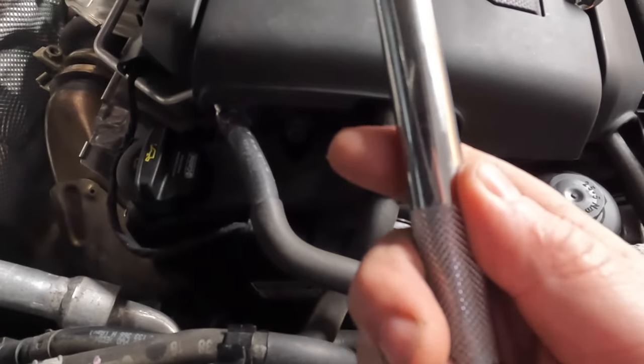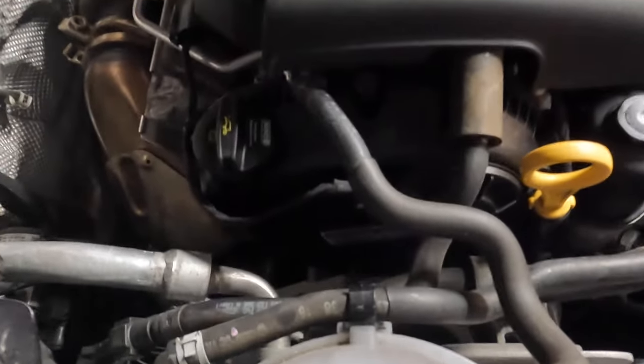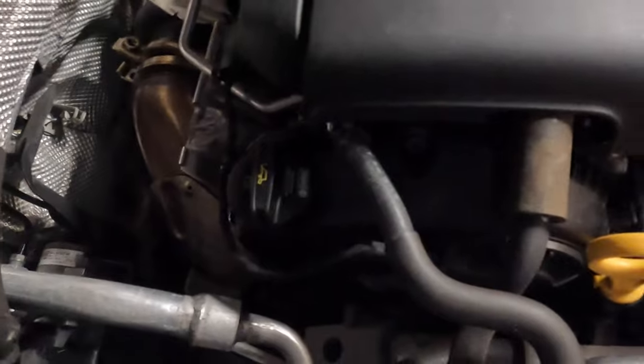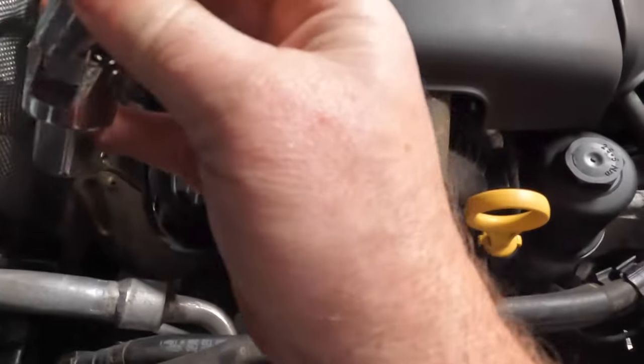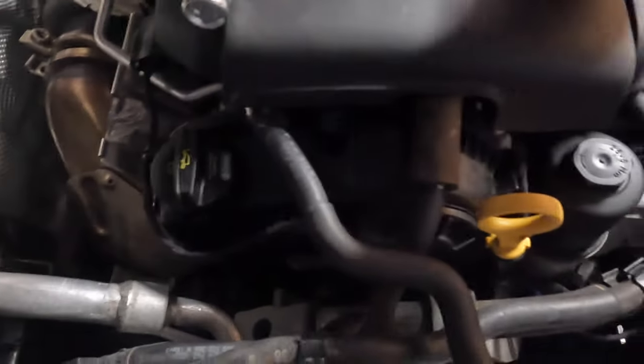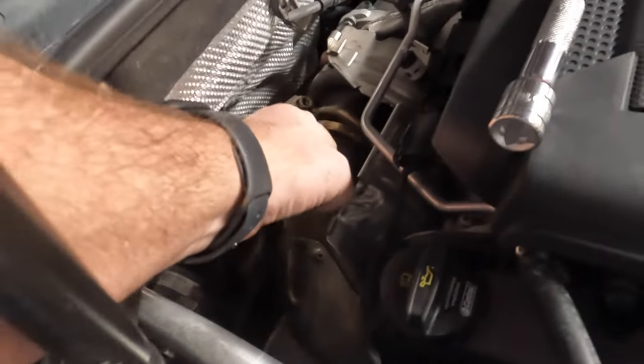I had to use a half inch drive to get some leverage in the right lengths. So half inch, probably a 9-inch. I have a half inch to 3/8 adapter. And then on the top, I put a half inch universal joint, and then a half inch, probably a 4-inch adapter. And then I threw the long breaker bar on the top, and then had to kind of hold it right here at the U-joint to get everything as straight as I could.